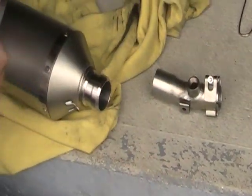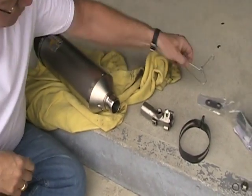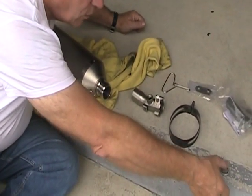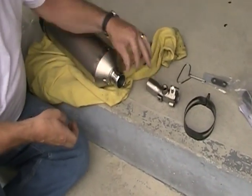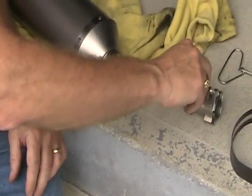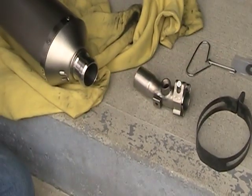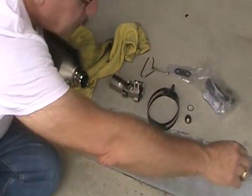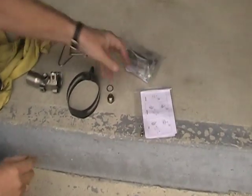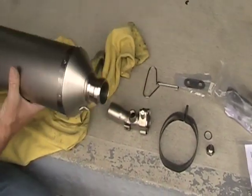This is the carbon fiber attachment that goes around the exhaust and clips onto the frame. The parts even come with a spring puller so you can stretch that spring. And if you have a 2007 or earlier Silverwing, you don't have an O2 sensor — in that case you would just install the plug into the O2 sensor port and be done with it. The instructions are quite thorough, quality is obviously there, excellent welding, all stainless steel. These little pieces are the replacement plugs if you pull out the DB killer. So those are the parts — very light.